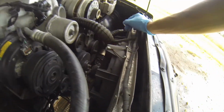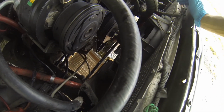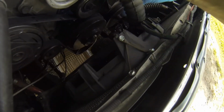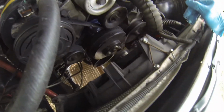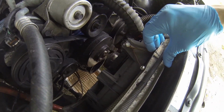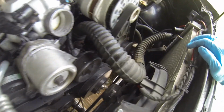I'm going to work on a different fan mount here. That's a little bit questionable. It did the job, however. The bottom fits into this fan shroud, but the top I had to do something. This was taken out of my Grand Am, my 94 Grand Am, from a 3.1 liter V6. The fan clears okay as long as you cut off the extra stud from the water pump. Everything fits alright. Very little clearance, but it's enough. So I've got to undo the overflow, the trans cooler, and then this rad's ready to pop right out.